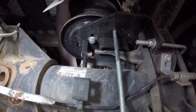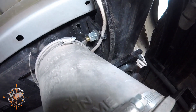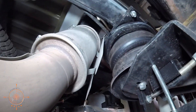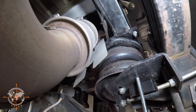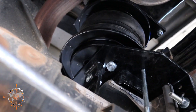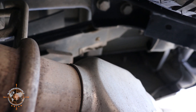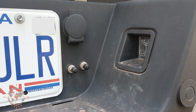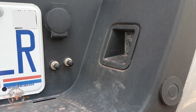The rest of it's pretty straightforward and easy to install yourself. I did have to remove both shocks to get them out of the way so I could slide the airbags in. Those bright nuts and bolts actually replace two bolts in the factory fifth wheel hitch. They give you a really nice heat shield to keep the heat off that airbag from the exhaust. The instructions are really good and simple to follow. Now it's time to install the air lines — I'm just going to run the air lines back to the rear of the truck and put the air fittings there by the license plate.